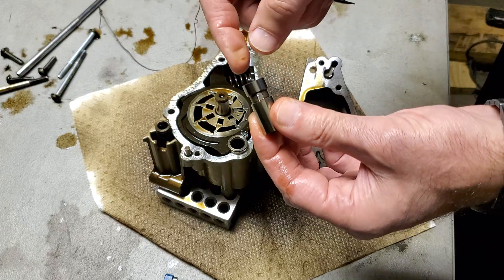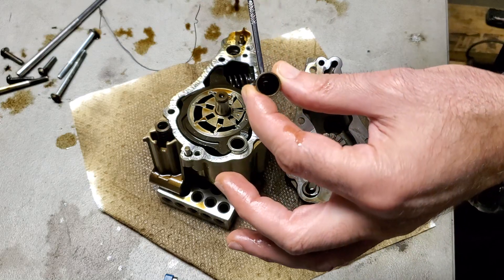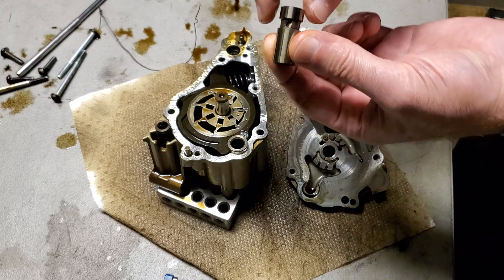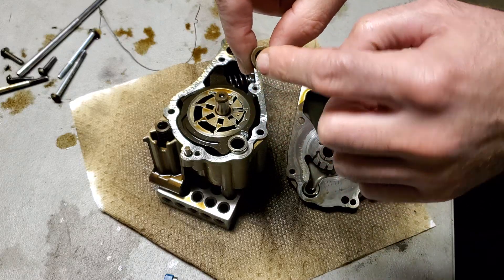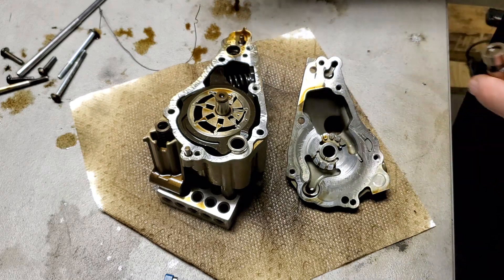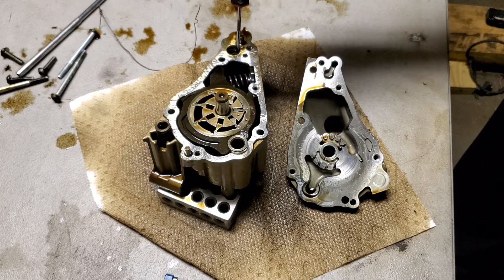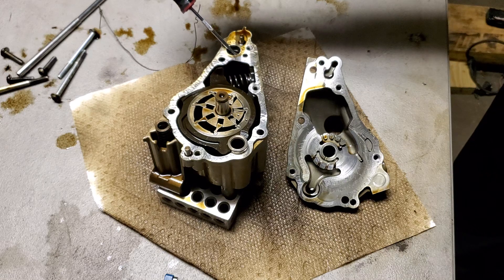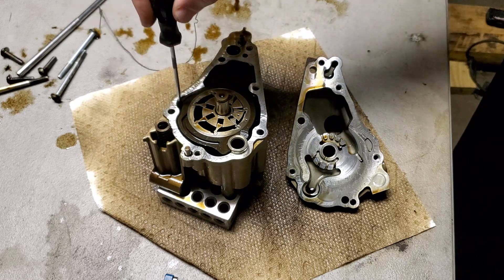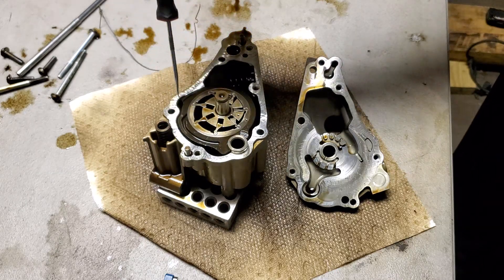If you look at this piston, it's got a hole in it and it's hollow. So no oil can come down through the top, but oil going in past the spring will come out this hole. Oil coming from the oil pressure solenoid will come up past the spring, go into this hole, down through this hole, then go across the back and come out into this area here, pressurizing this side of the pivot.